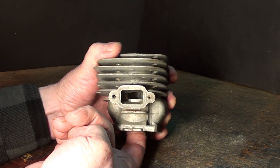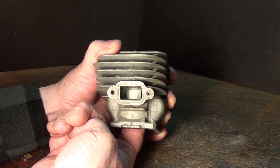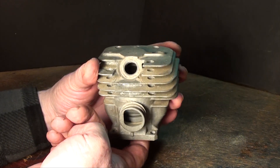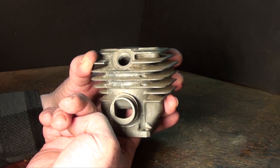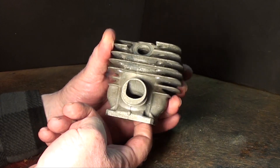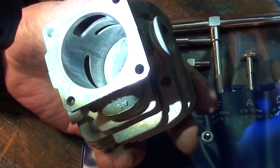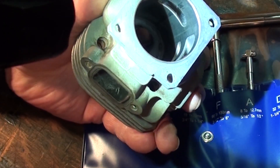You can see here in the exhaust port that the piston skirt closes off the port for compression and ignition. Looking in the intake port, which is positioned lower, the piston goes right past the port and allows for the crankshaft and connecting rod to be lubricated by the fog of air, fuel, and oil. Inside, you can see passages connecting the crankcase below the piston to the combustion chamber above to allow fuel vapor to cool and lubricate all the surfaces.